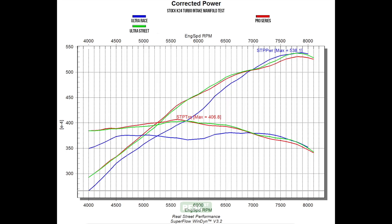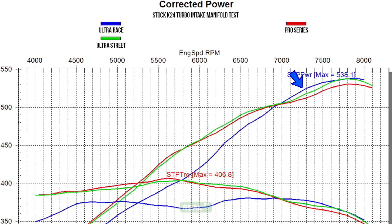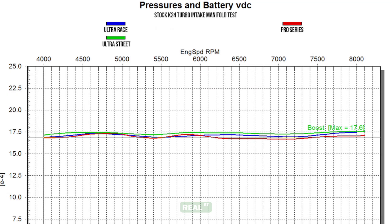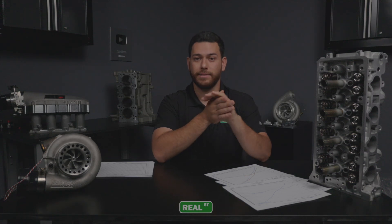Here's where the test got a little more interesting. While we did see a little more power up in that higher RPM with the Ultra Race manifold, we did see a huge dip in torque, especially down low in the lower RPM section. With the Pro Series manifold we had less horsepower up top but made 406 foot-pounds of torque, whereas on the Ultra Race manifold we only made 380 foot-pounds of torque. There is a section where the Ultra Race outperforms the Ultra Street for a couple hundred RPM while keeping a very similar peak horsepower number. This is all at the exact same boost target throughout the whole run, as you can see the graphs laying over that boost target throughout the entire RPM range — the target stayed the same and the only difference are the intake manifold and, in the third run's case, the throttle body.